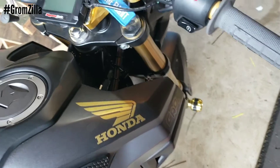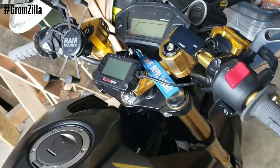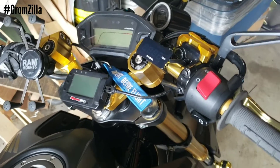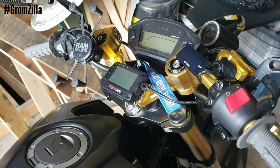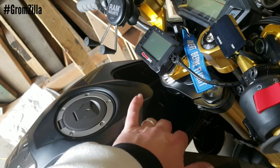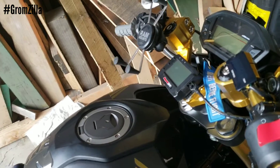As you can see in the me launching the bike, obviously it needs a little more work. The idea is to get it to where it pulls the front end up a little bit but doesn't dump you on your head and end up looping the bike. But as you can see in the videos, two-step is working properly — this is how you set it up on the Honda Grom. If you have any questions, please let me know and I will answer them as best I can. My little brake switch that I'm using in the back is on Amazon — I believe it's only about $10. I will leave a link in the description where you can purchase that. And the switches are simply an on/off switch that I went to the local auto parts shop and bought. They're simply a two-prong on/off switch — any two-prong on/off switch will work on the Power Commander, as long as one way is on and one way is off.